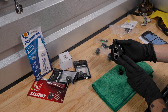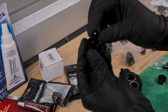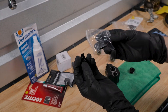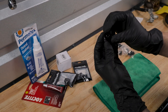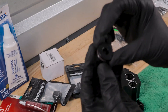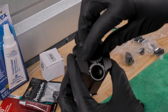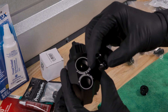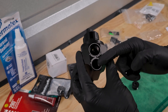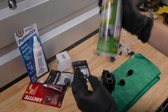This is the side that's going to face towards the car. You're going to need this fitting here — it's some type of fitting with a barb end to it and it has an O-ring. There's actually two of those. The second one is some type of MPT plug with threads and an O-ring. The one with the plug is going to sit on the top port — it just threads through. The bottom port with the hose barb fitting is going to sit on the low pressure out, which is the one going back to the tank. We're going to use silicone lubricant to lubricate the O-rings and make sure they don't break.